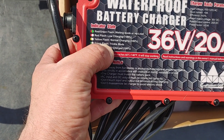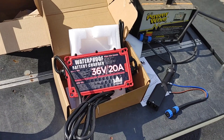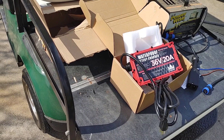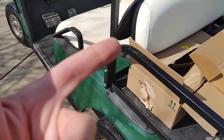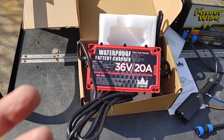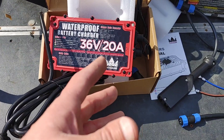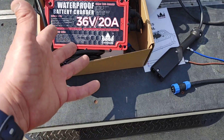The indicator lights work like this: waiting for low charge, normal charge, trickle charge mode, and fully charged. The idea of running three 12-volt batteries is to save money. Good golf cart batteries like Trojan cost $1,200 to $1,800. This setup is less than $270 in batteries, and people claim they last four to eight years. This charger runs $200 to $230 — I'll link it in the description. That's a one-time purchase that should last ten-plus years.